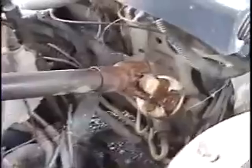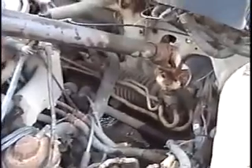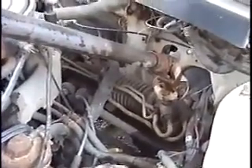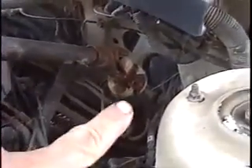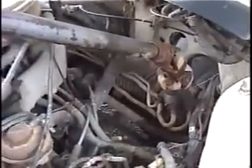The steering shaft is just a piece of one-inch pipe that runs down to an ordinary steering universal joint that comes from any car. The steering rack is a firewall-mounted type that only comes on these GM cars, so I rotated it 90 degrees so that it sticks away from the hole in the firewall and points in this direction. I had to twist the power steering lines a little bit to do this.